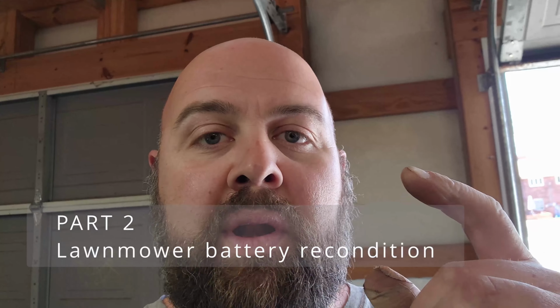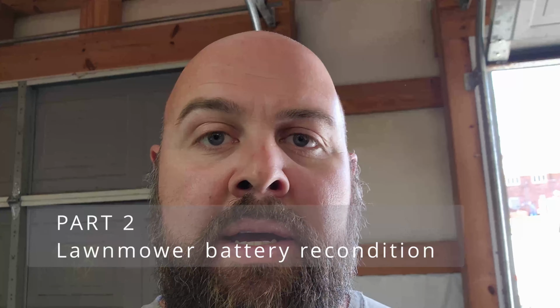All right, back for another battery recondition video. I didn't put my lawnmower battery on trickle charge and leave it on that all winter, so it sat. I just hooked it up to the charger. It said 12.4 volts. I'm going to do a load test on it, record it, and then let you guys see what happens from there.